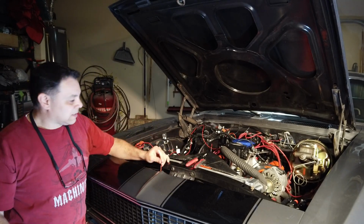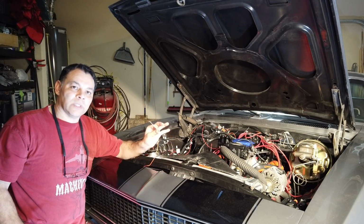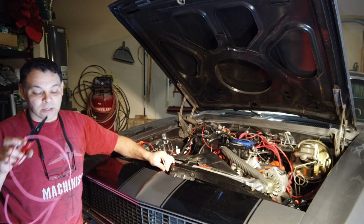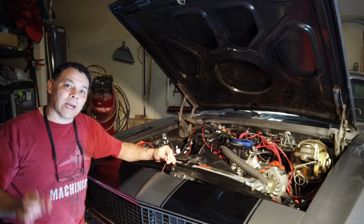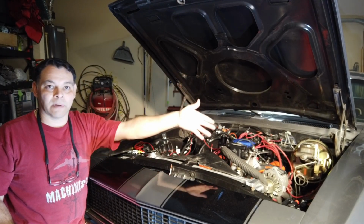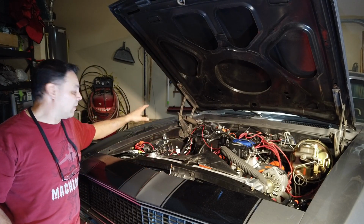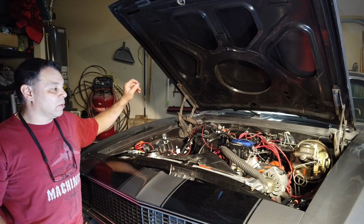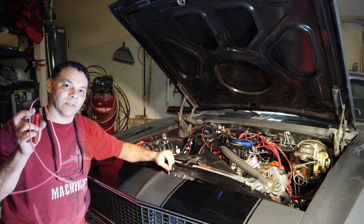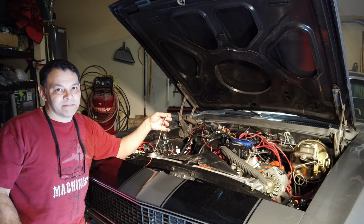Now, this I believe is 14 gauge. It's 14 gauge, what it comes with. This is 12 gauge. The reason why I'm going to up the size is because I'm hoping that I have less voltage drop, okay? Because of the extra length. I really don't know how it functions with the system, so I don't want there to be a voltage issue. So that's why I'm going to up the size of the wire. And I'm going with pink, even though this is kind of a pinkish orange. Should be good enough. We'll give it a go.